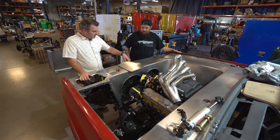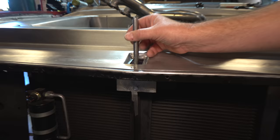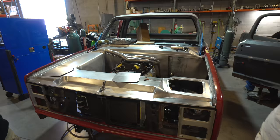This is our hood latch. We've got the striker that's going to get mounted on the hood and hold it down — a nice, simple way, keep it simple. It's basically a door lock actuator, a bear claw style latch, but it's also electric and has an actuator built in, so it has some cool features. Cody shaved the upper cowl right here — we could have left it open, but it just wouldn't have complimented the look when the hood is up.